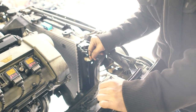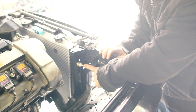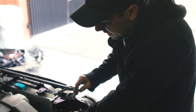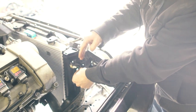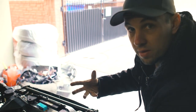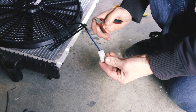The last piece of the puzzle is the trigger wires that bridge the relay, and that is done through this 82-degree fan switch — I'll link the part number in the description. This is the one we like to use; it's very straightforward, just two prongs. Once we connect these and the coolant gets to 82 degrees Celsius, it's going to close the circuit and send the signal to the relay to bridge, which then sends power to the fan, kicks on the fan, and starts cooling the coolant. I hope that explanation makes sense — that is the whole theory of what we're doing here.